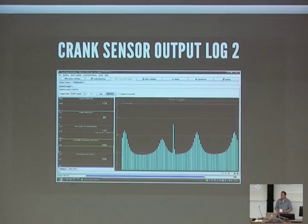What's happening in that picture? Changing revs — but in a very specific way. This is actually what it looks like when an engine is cranking, and every time the values go up, you're hitting a compression stroke which makes the starter motor slow down. You've got to be careful not to put your missing tooth right in the middle of there because it becomes very hard to detect. In the four strokes, one stroke is compression where the engine is compressing the mixture. When you're cranking on the starter motor, it applies a fixed amount of force, so at the compression stroke it has to work harder and slows down — that's why you get this kind of waveform.